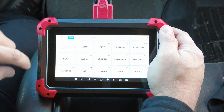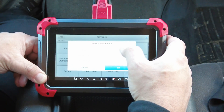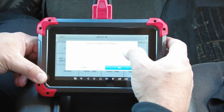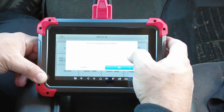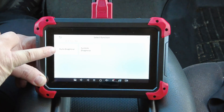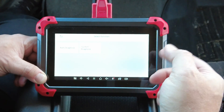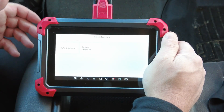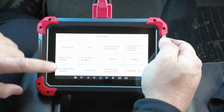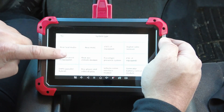We'll go into Diagnosis, go to Auto Scan — and going to Auto Diagnose is where it scans through all the modules in the vehicle and gives you all the trouble codes for each one. We'll go to System Diagnose here, and you'll see that in this 2006 GMC pickup it'll show you pretty much every module in this vehicle. Let's go to Powertrain for example.